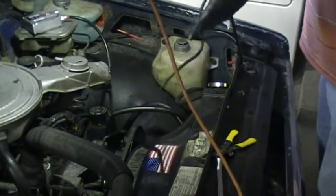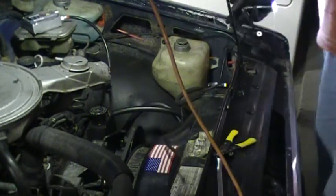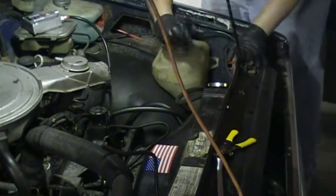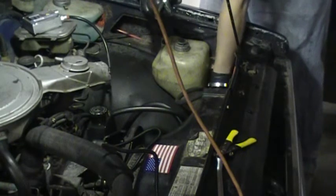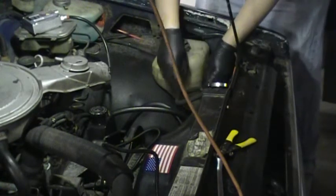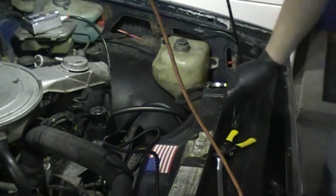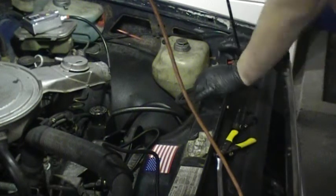That's another thing. Some of the cheaper kits, I mean, obviously any company, they're going to want to give you the minimal amount of wire because it saves them money in the long run. Then it makes your install harder, makes it harder to put things where you want to. So you kind of gotta get everything hooked up first, I think, and just see how much wire you have to play with, see how much slack you have, and then start figuring where you want to mount things. Because if you go ahead and say, okay, I'll mount the ballast there on the fender well and drill the holes and take the time to do all that, and then you realize, well, I don't have enough wire, then you either got to extend the wire, or, you know, you just wasted your time and you got to mount it somewhere else.